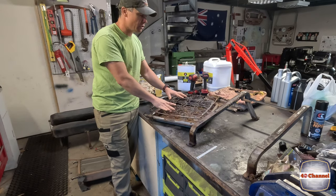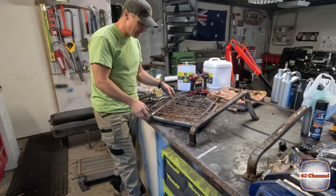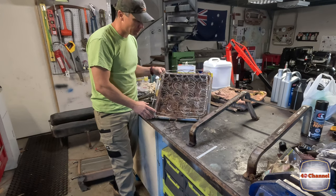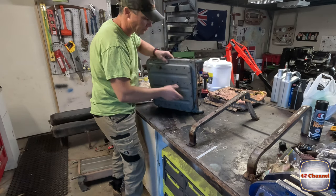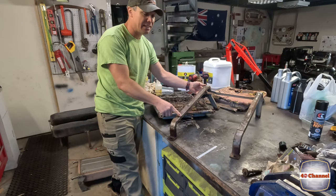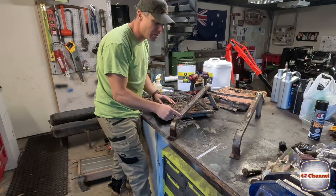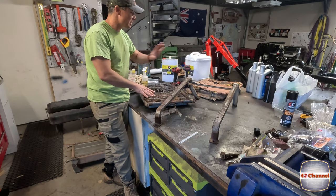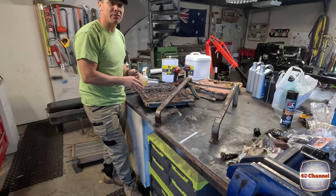There's a little bit of fabrication we're going to have to do - make up some little clips, little brackets, some support rails to bring this seat back up to where it should be. We're going to make up a new support rail, sandblast the whole lot, clean it up, and repaint it all in light gray. This support rail here is missing too - same thing that was missing on the FJ40 we had to make one of those as well. There's a bit of work to do before we can take any of this to the upholsterers. I want to give him all the framework so he has everything to work with.